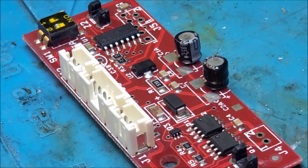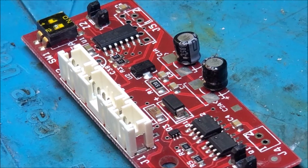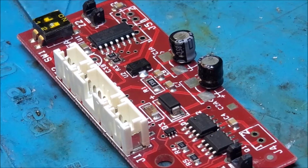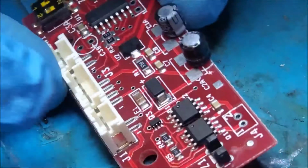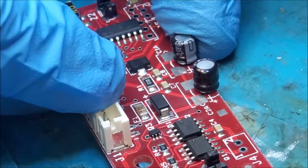So when I test the fuse on my continuity, we want to hear it beep. Oh, what the hell, it's beeping. Now not only is it beeping like it's good, it's fooling you. Trust me, that sucker is bad. We are going to put another one in.